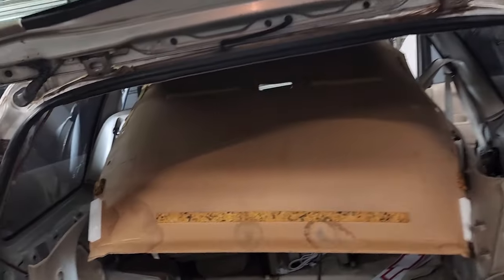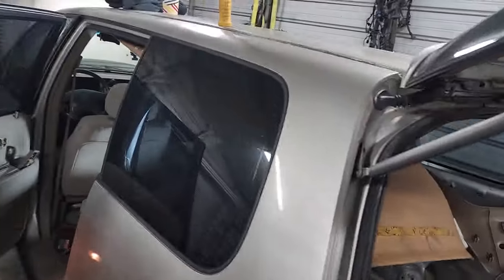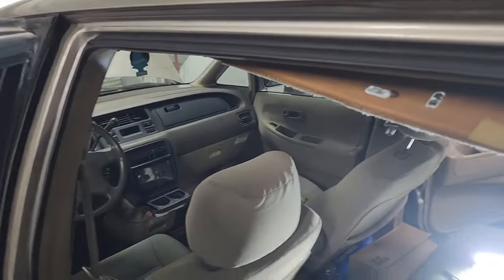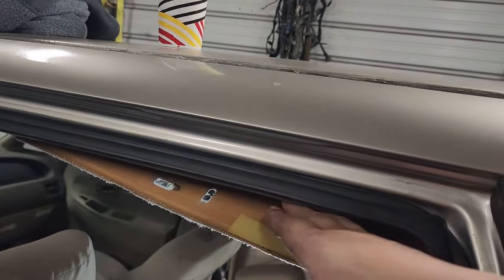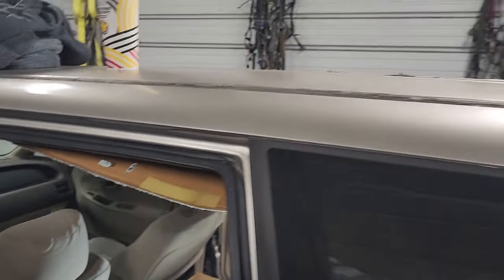What is going on YouTube, welcome to Car Audio 101 with Del. Right now I've already started tearing into this thing — this is what I call my cheat way of putting deadener in the roof. I never pull the entire headliner down, never take all the pillars down. Instead I just kind of fold it down and get about a foot gap between the roof and the headliner so I can get in there and do the deadening.